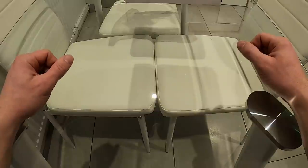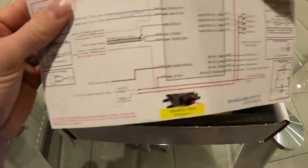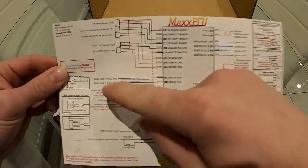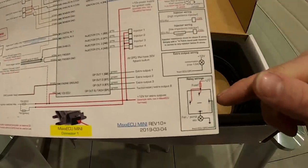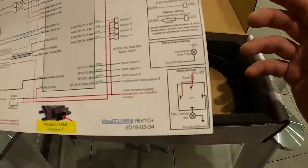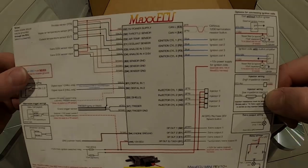So if you've just bought a Max ECU Mini and Zetec loom kit off me, this is what you get. First you get the Max ECU Mini in its box. You also get a little mini quick-start wiring diagram — it shows you what all the pins on all the plugs do, how to wire up things like oil pressure sensors or wheel speed sensors, how to change coils and rewire them, and how to wire up a fuel pump relay — which is handy if you've chucked a Zetec into a Westfield, Lotus 7, Mark 2 Fiesta, Mark 3 Escort, or whatever.